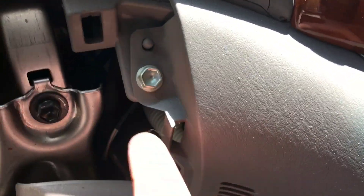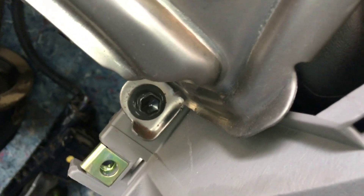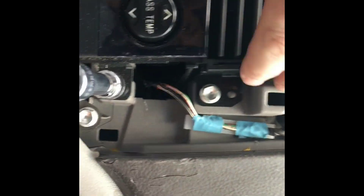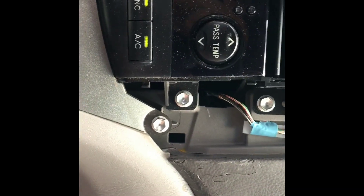I took this panel off — it also had one of those plastic securing mechanisms. I pulled it off but this panel still wasn't coming off, and I just realized there's another bolt I need to take off. Took that down, popped this down, took that panel off, realized there was something on the other side holding it. When I pop these two corner pieces off, we see that there's one more screw — going to take that off with a 10 millimeter socket.